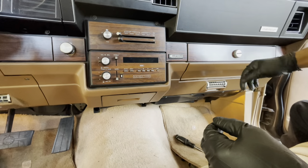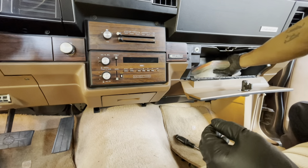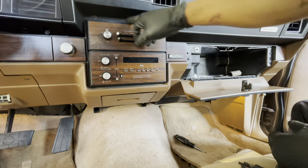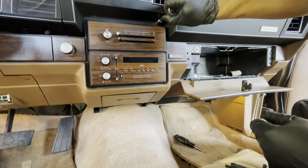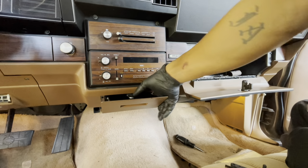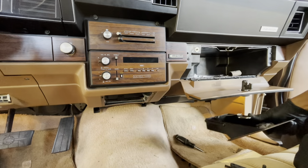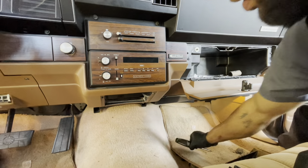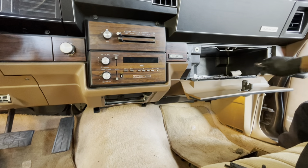Back to the video. You're gonna need to remove your glove box. Open your glove box, whatever's in it, take it out. These two screws right here, take them out. Take your ashtray out — push down on that little middle thing, slide right out. You're gonna need a Phillips too, cause you got a Phillips here and a Phillips here.